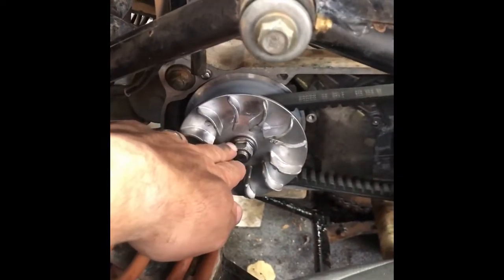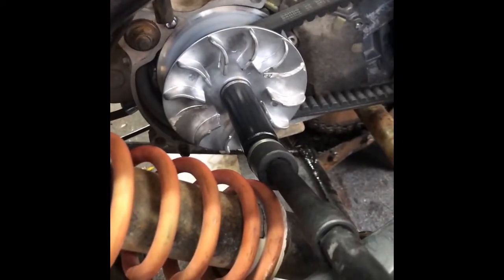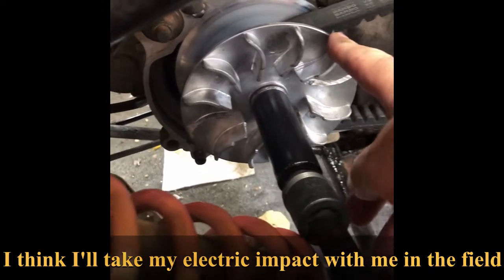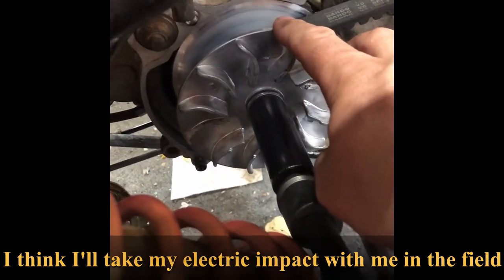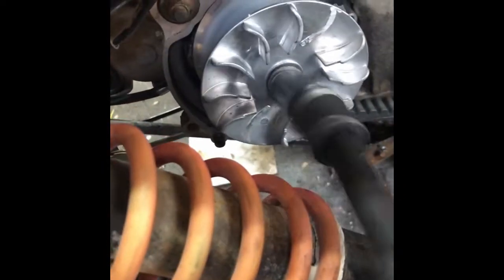To keep this video short, the magic is right here on this front pulley. I'm going to pull this nut off and pull this assembly off — it comes off pretty easily. Get yourself a swivel, otherwise this is going to be difficult. This is actually pretty difficult to take off without an impact wrench. You've got to find an oil strap wrench or something to hold this aluminum wheel in place, because you can't hold it with pliers — you'll break it or dig into it. Okay, so there's that one nut and a washer.